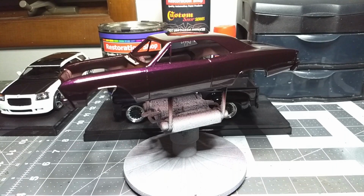Make sure the clear coat is still pretty soft, not hardened, because you don't want that. You don't want the clear coat to be hardened. At least make sure you clear under the 24-hour mark. Otherwise, you're going to have to wet sand it, or rather actually sand it down, and that's the last thing you want.